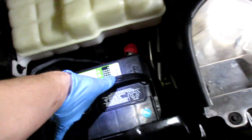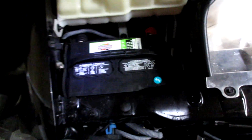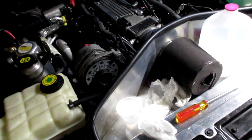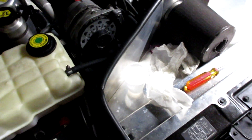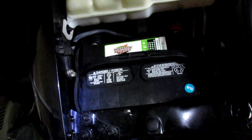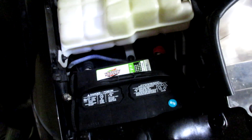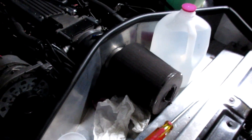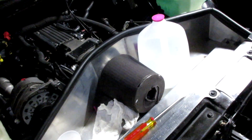Hopefully that helps someone who wants to check their water level. I'm thinking you probably shouldn't do it on a battery right after you charge it — the hydrogen gas is probably high, and the battery very well could explode in your face. Explosive gas is hydrogen gas — no open flames, because it will blow up. Even when you spark the battery hooking a battery charger to it — if it's gassing, it can blow up. I usually put the ground somewhere far away when I do it, or charge it from the auxiliary post if equipped. So that's my video — like, comment, subscribe. Check your battery water if you want. Use distilled water — do not use tap water.